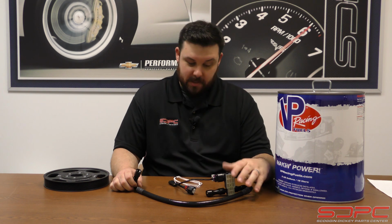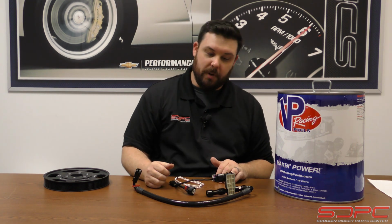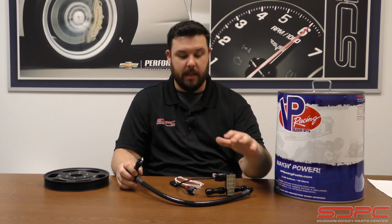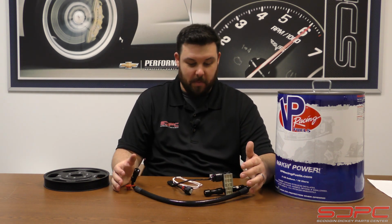Now, they make other products. This isn't the only thing they make, but everything they make is high quality like this. They also have auxiliary fuel systems. If you, on the low side of your direct injected engine, need an auxiliary fuel system, help feed some of this stuff. When you go E85, you need about 30% more fuel. You start cranking that up, you might need some help. LT4 pump and injectors if you're doing like an LT1 car, or that auxiliary pump to help feed your high pressure pump. They also have add-on kits, same thing. They are made specific to your application. And they come with the same great craftsmanship that I have here in front of me.